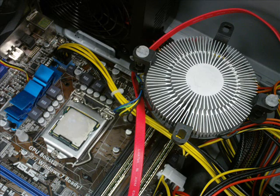Either the top of the CPU itself or the metal plate on the cooler should have a thin layer of thermal paste. A very thin layer will do. Applying too much paste will make the cooling less effective. Now we'll put the cooler back on top of the CPU.